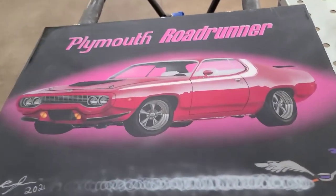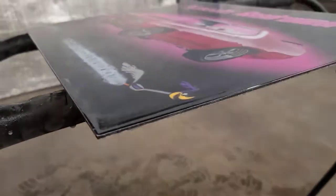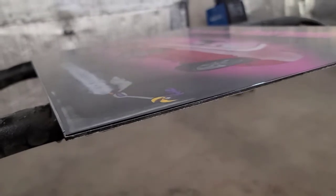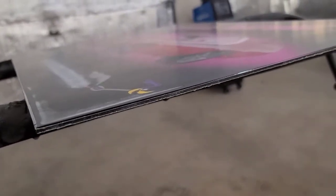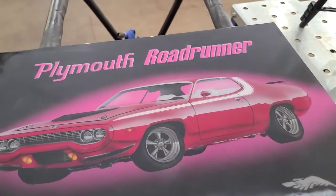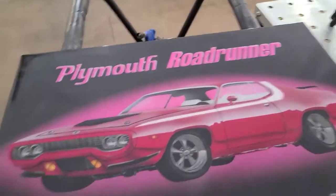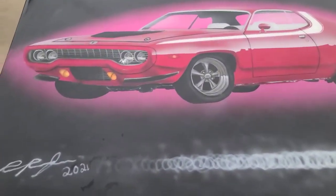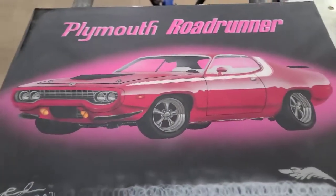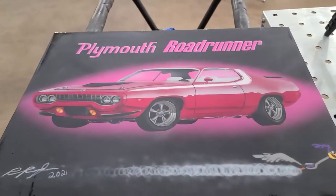From this point I'll wet sand with 1500 after this — this is 1000 grit. If you take a look, you do get a reflective shine just a little bit. You can see it up in the upper right-hand corner reflecting there. Once you do 1500 and 2000 it shines a bit more. If you were to hit this with 3000 or 5000 it almost looks pretty shiny, but I don't have any today so I'm going up to 2000 and then polish it.